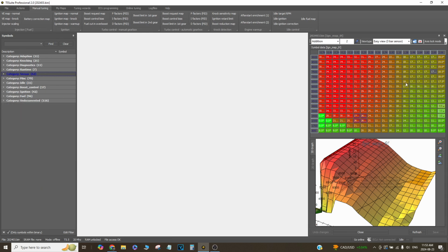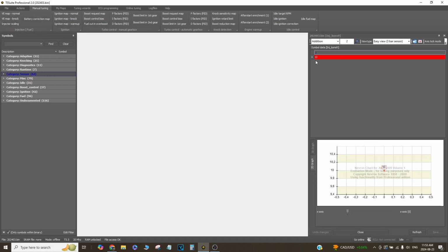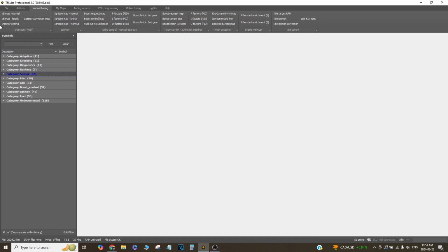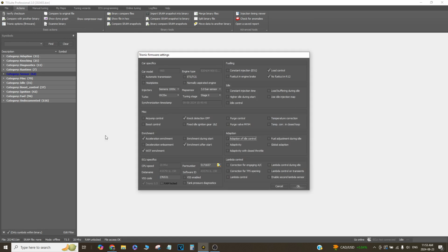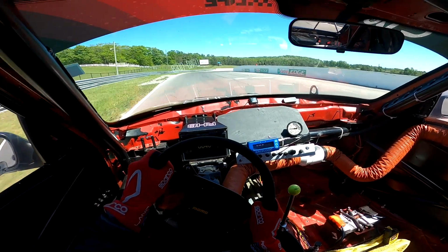Of course that's specific to your engine and your needs, but the main takeaway from this video is not just me showing you the numbers that I actually run. It's my method of tuning, which is just get rid of all the stuff you don't need. Oh yeah, injector scaling's at 10 because I run 1600 cc injectors, I believe, 1550s at 5 bar base pressure, so that's what the number ends up being. The key takeaway from this video is I just get rid of every single thing I do not need in the ECU to make it easier to tune, easier to diagnose, easy to drive.